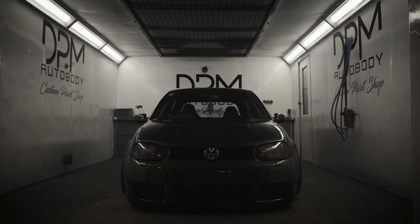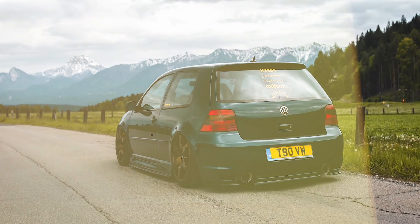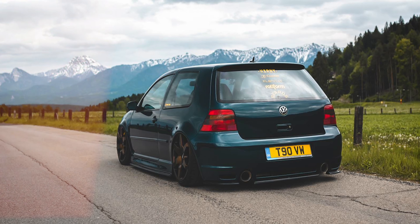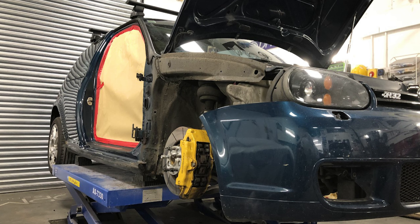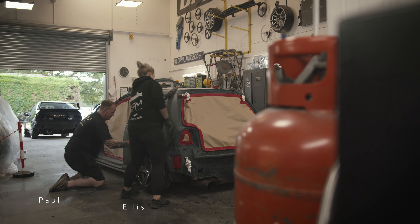A project we've recently been working on is a VW Golf R32. It originally came to us with accident damage, and the customer then wanted to go for a full custom colour change. We went through stages of removing the door mouldings, welded flush all the holes in them and on the rear quarter panels, as well as cutting and extending those front arches around about 25mm, so when the car airs out it sits as it does now.